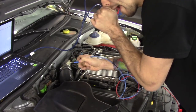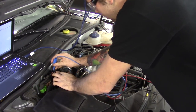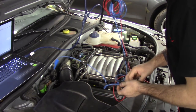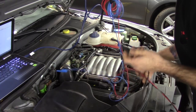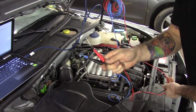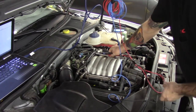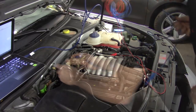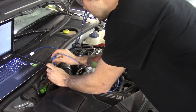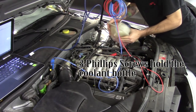So bank one is going to be our channel A, our blue. And pin four is our signal. And then we're going to use the actual sensor ground. It's going to help clean it up and take out most of that interference. And then the red is going to be our bank two, sensor one, the one that we're having the fault for. So pin three is our sensor ground. Coolant jug out of the way.